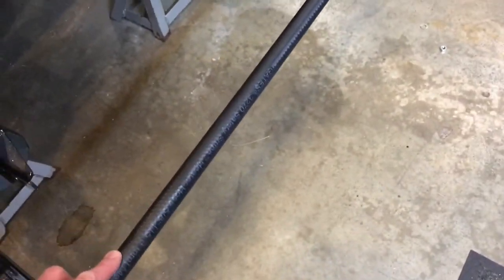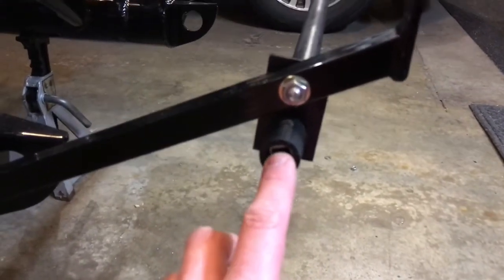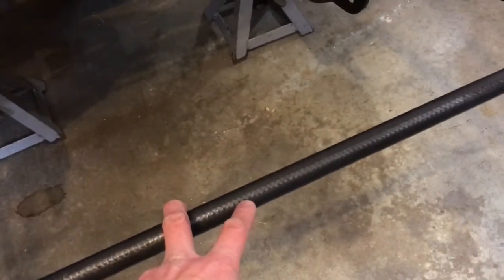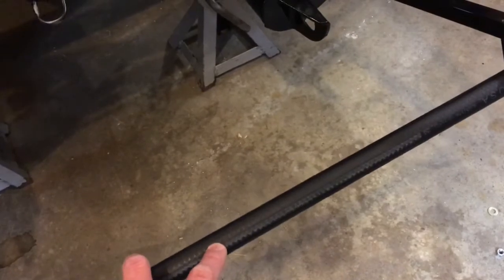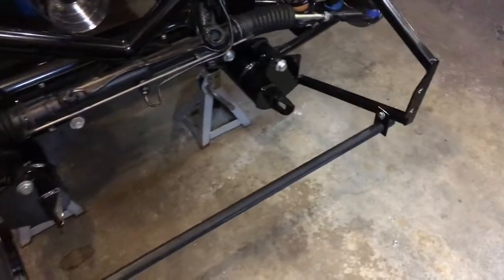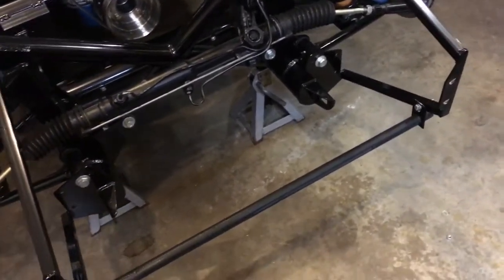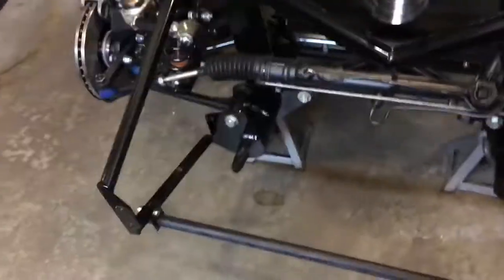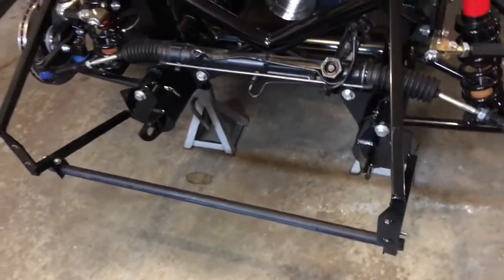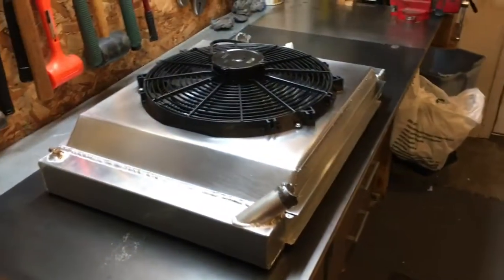This is a 5/8 heater core hose over a half-inch piece of steel tube. Once you get your radiator lined up, you can anchor through that bottom tab to keep it from sliding back and forth, and it also anchors the bracket itself. The cushioning helps with shock loading on the radiator. The body of course mounts to it for support, but this is just an additional step — I wanted to go the extra mile to make sure it's well supported. So that's my cooling setup.